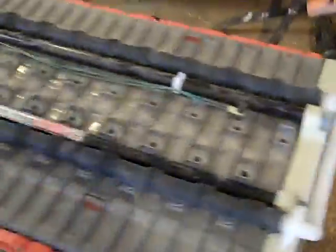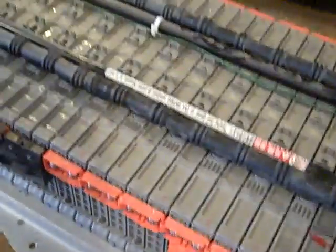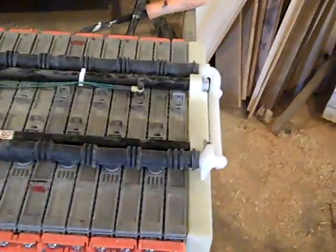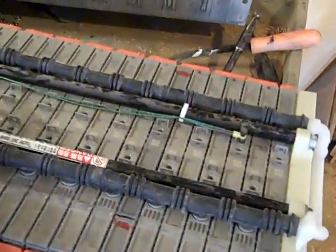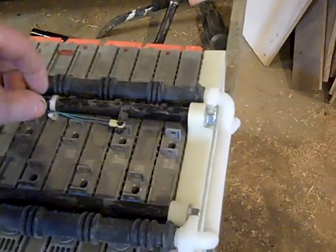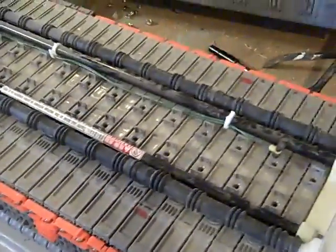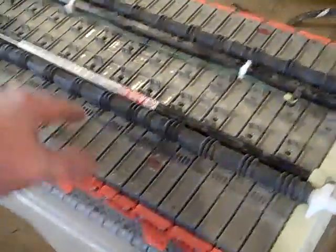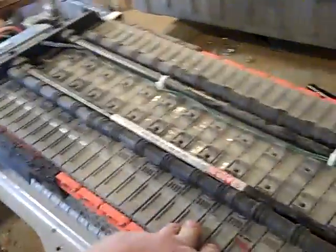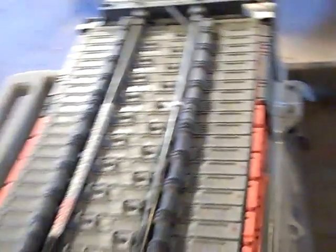They also have cooling tunnels that go underneath and above, and there's a cooling fan that sits back by the battery in the car. If your cooling fan is plugged up with dog hair or whatnot — there's no filter on the cooling fans — your battery could also fail because of overheating. They want to keep these temperatures low enough that they're not going to cook the battery and get too hot. So the cooling fan is also something you want to look at when you tear it apart. Mine — the car I bought has 130,000 miles on it — the cooling fan is actually in tip-top shape. There's a little dust on the fins but not too bad, even though the car clearly had been well-used in those 130,000 miles.